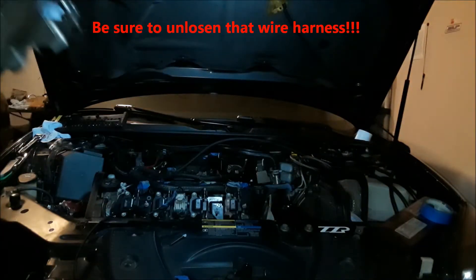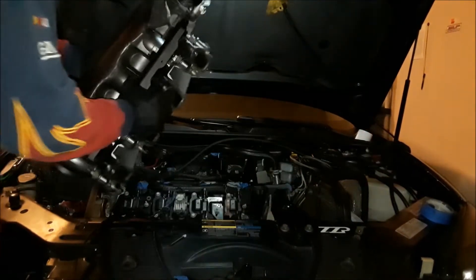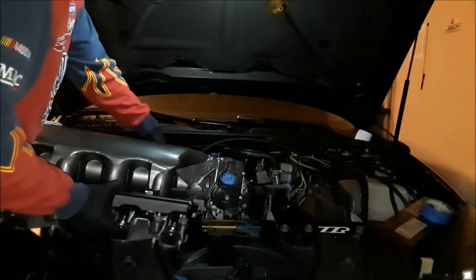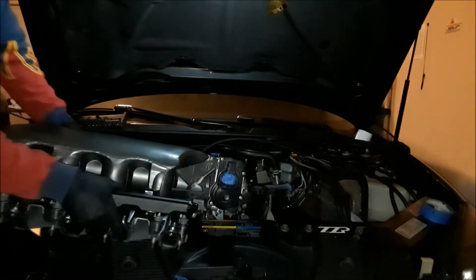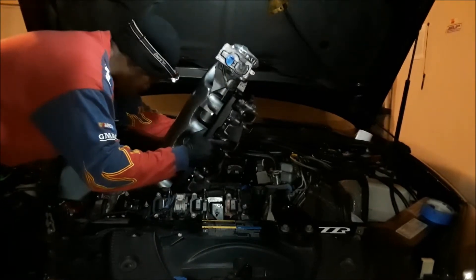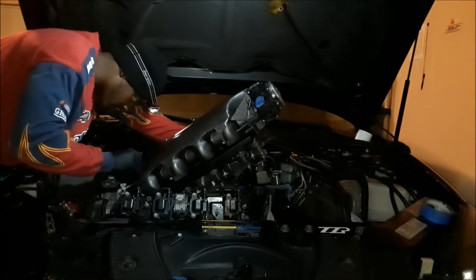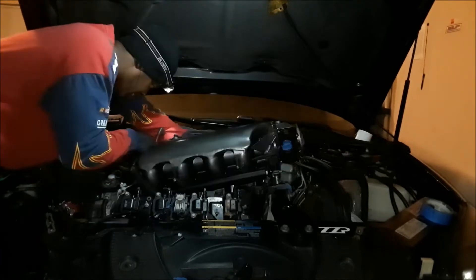You want to be very careful putting this in here because your oil pressure sensor sits here. I came in, set it in, and kind of slowly just start setting it up, pushing it in, and at the same time just hoisting this over the back side of it — being very careful of the oil pressure sensor. So what we do, we come in this way and we drop it just like this. We're looking at the wires and stuff, scooting, pulling this up over it, very carefully like this.